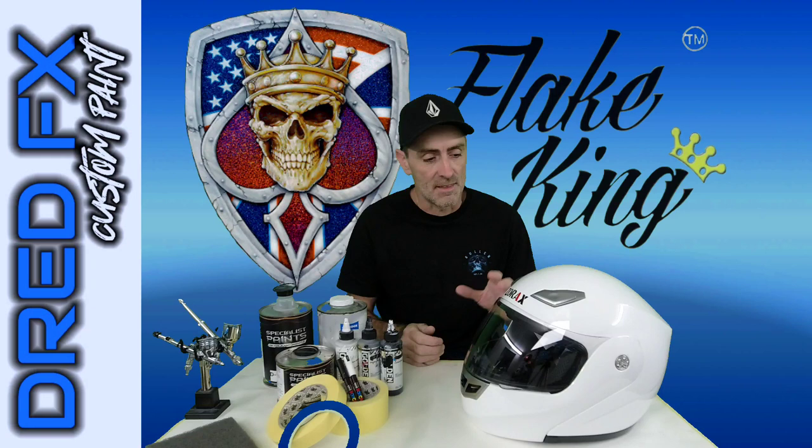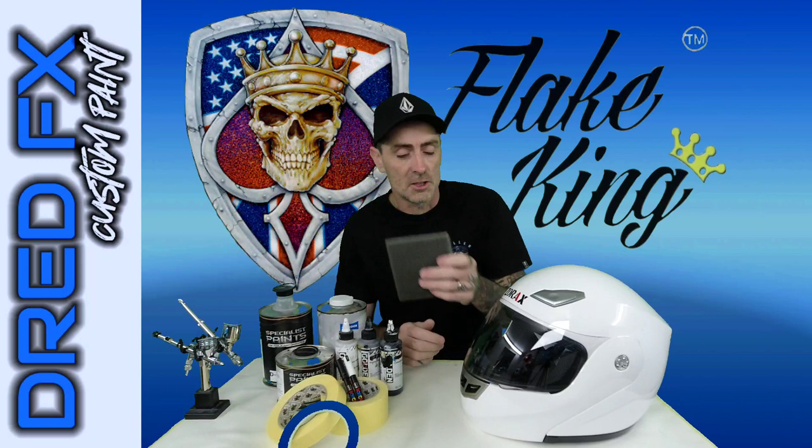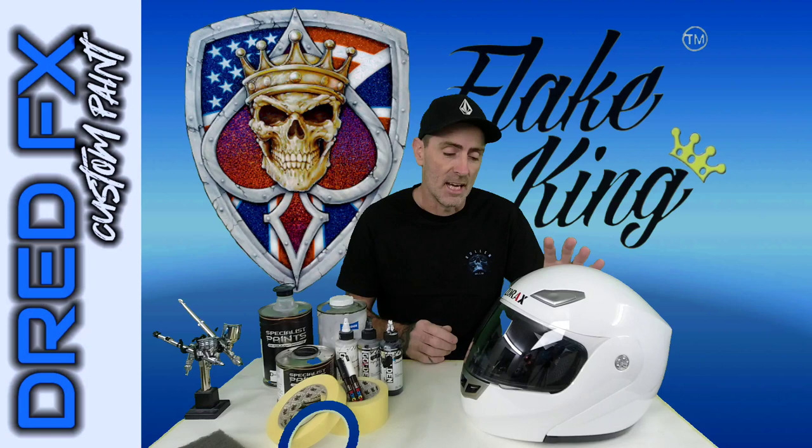First of all, we're going to need some panel wipe, degreaser, to give the lid a good clean down, and then to prep this, as it's a new crash helmet, we're going to Scotch-Brite it and just give this surface a really good key so our paint adheres to it.